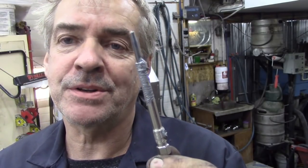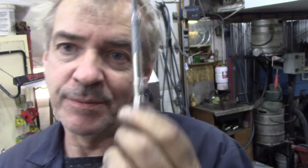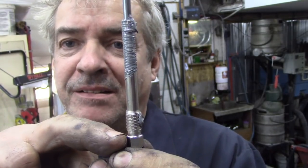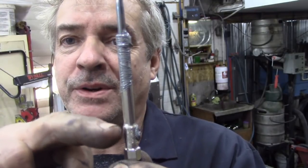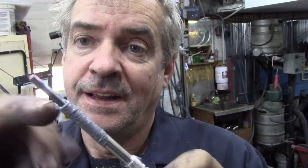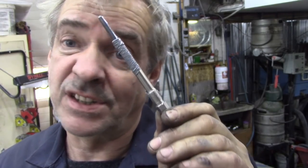Why do we put it down at the bottom? Well, when we push that in, it's got to lubricate the head where this goes in. Nine times out of ten, when you snap a glow plug off, it will snap off here. Maybe here. But most of the time it's one of these points here. It doesn't snap off down at the bottom, because what happens is, when these glow plugs burn out sometimes, or they're old, these swell out, it all swells up. That means it's a bugger to get out. So the resistance is all down here. It starts to get carbon up this tube, and then they won't come out. So you're stuck. You really are stuck if these won't come out.